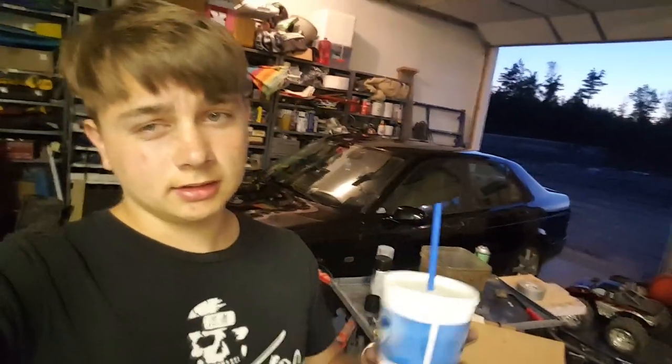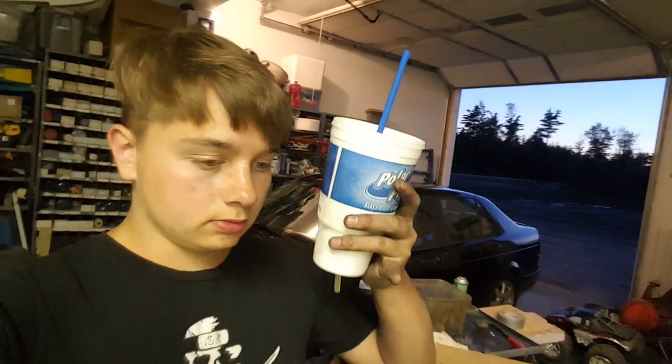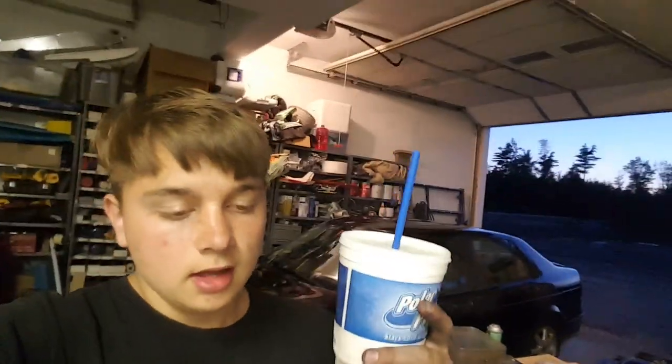I'd like to give a shout out to Mike D for giving me the idea of poking through the air intake manifold to get the top piece of the clip pushed in while grabbing the bottom piece with my finger and then slightly prying it off — that was the best method I could figure out. If this helped you, leave a like, comment, subscribe, all that fun stuff. It runs good — I just took her for a ride for a victory drink and she's looking nice and clean right now.